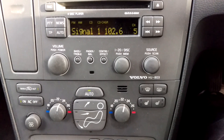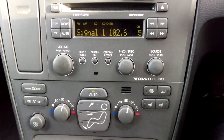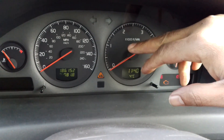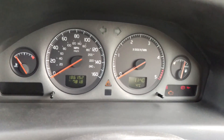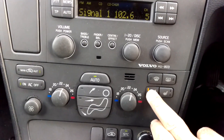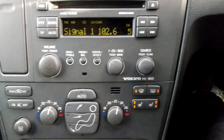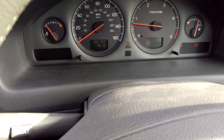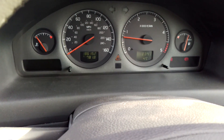Ideally when you're testing your alternator, if you've got someone to help, have the engine revs at around 1,500 to 2,000 RPM. I'm working on my own today, so the important thing is to get the engine running but then to load up the electrical system so the alternator's actually having to work. I'm going to put everything on that I can — main beam — so that's as good as running the engine at higher revs, because I want a good load going through the alternator.